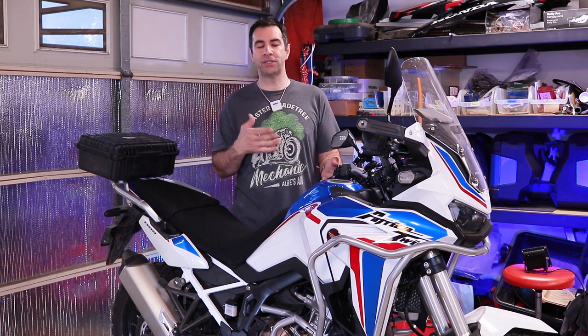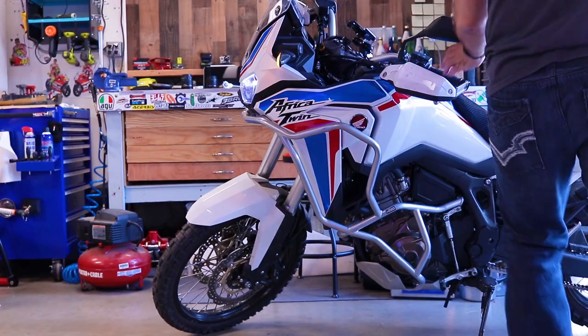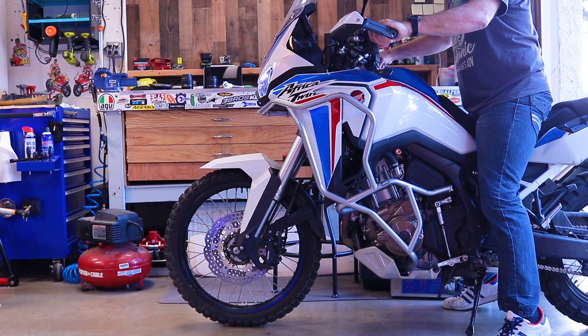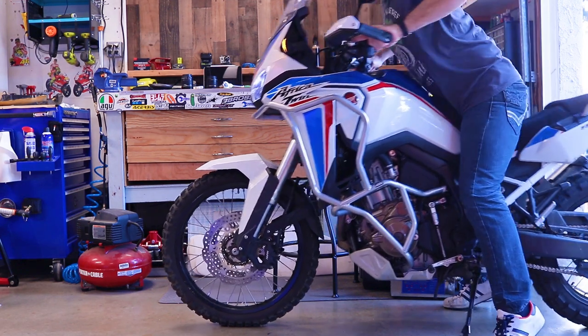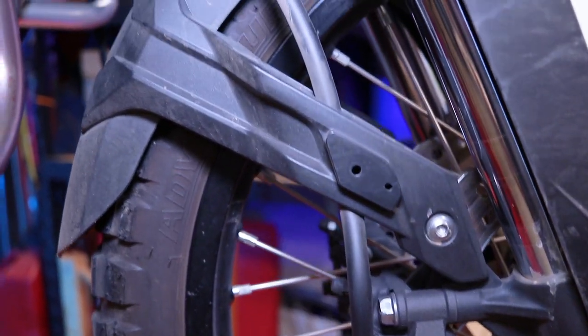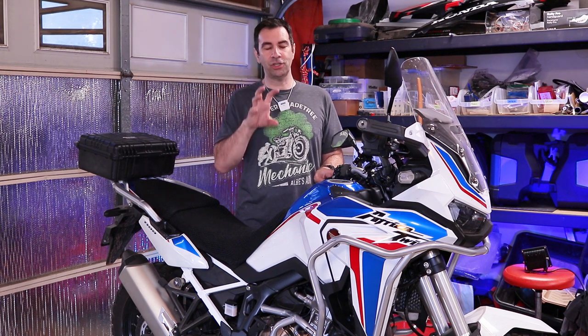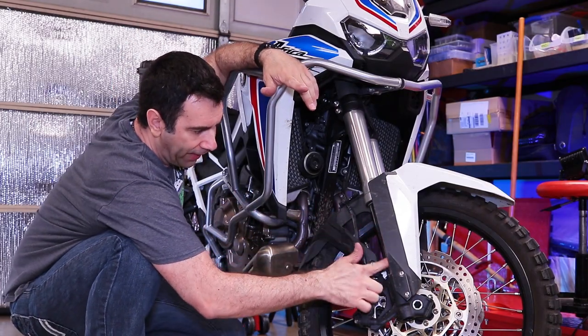If you ride your bike constantly you'll already know about most of this stuff — if the idle is too high you'll know about it. When it comes to the suspensions, get on the bike, get on the brake, pump the suspensions, and make sure everything is fine. After that, give them a good look — look for leaks, scratches, and gouges on the fork tubes. Very simple — a few mechanical skills are required for a few items but most of the other stuff is just paying attention to your motorcycle.